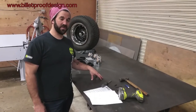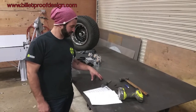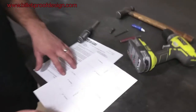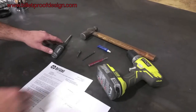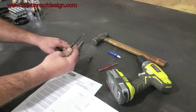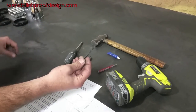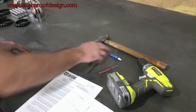This is a very easy install and requires minimal tools which most people have at home. The kit comes with detailed instructions and two templates just in case you mess one up. Tools required are a screwdriver, cordless or electric drill, directions say a 5/32 drill bit but I like to use a slightly larger bit — an 11/64 — which allows for a little more fudge factor, plus a center punch, hammer, and some Loctite for the fasteners.